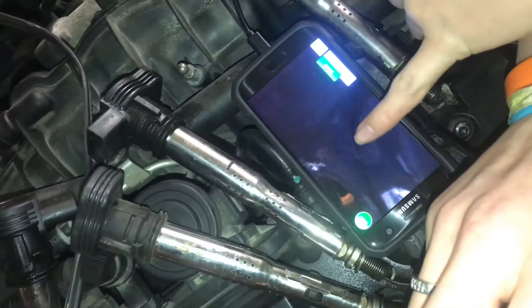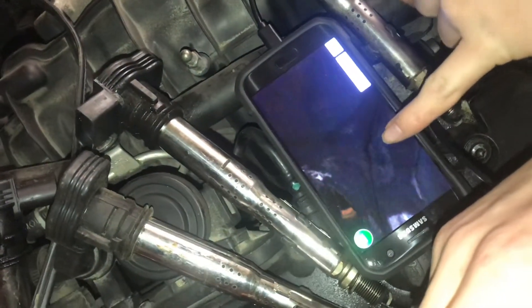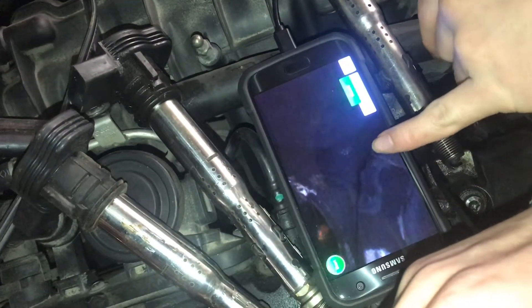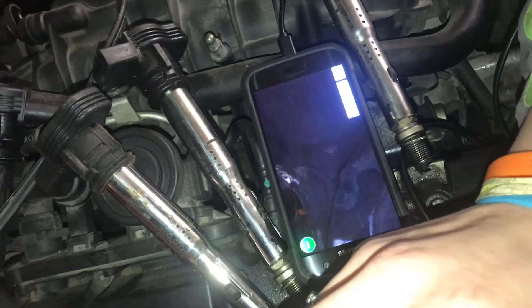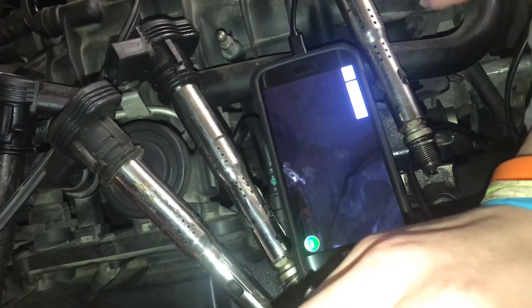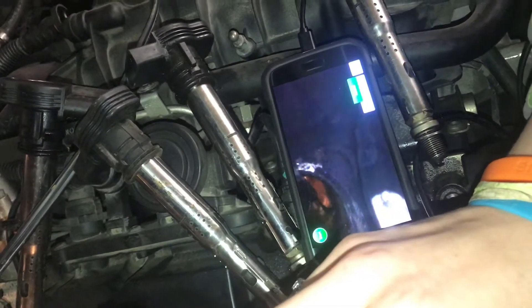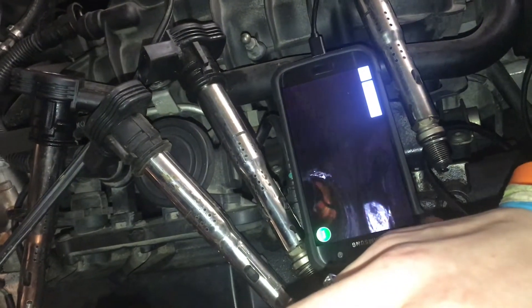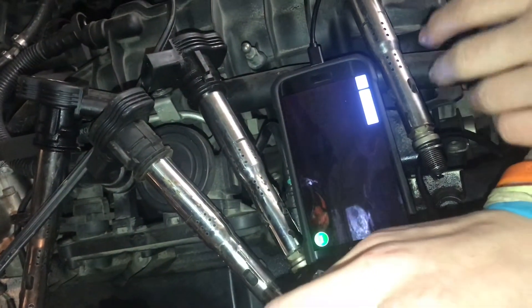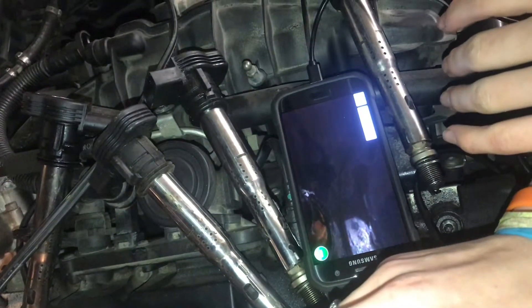Right here this is the edge of the valve. It looks like there's a little bit of a bump or a burr along this side, which definitely isn't supposed to be there — whether it's carbon build-up or something like that. That could be causing it not to seat properly. I'm not totally sure if that's just corrosion or carbon build-up, or if the valve is actually starting to burn away there.